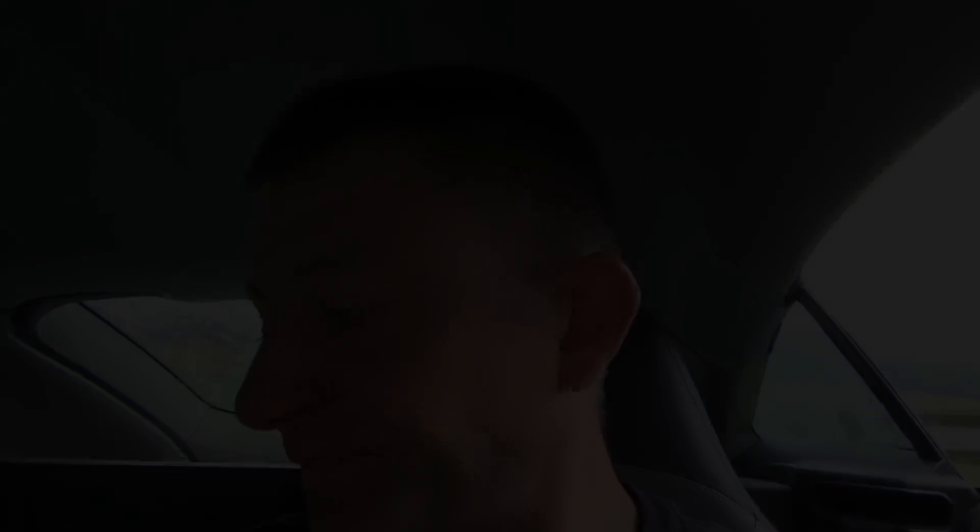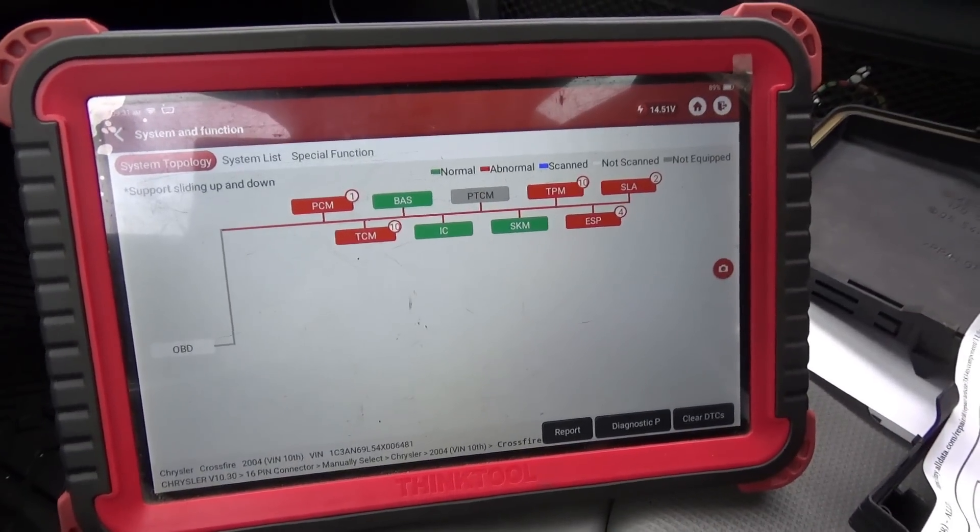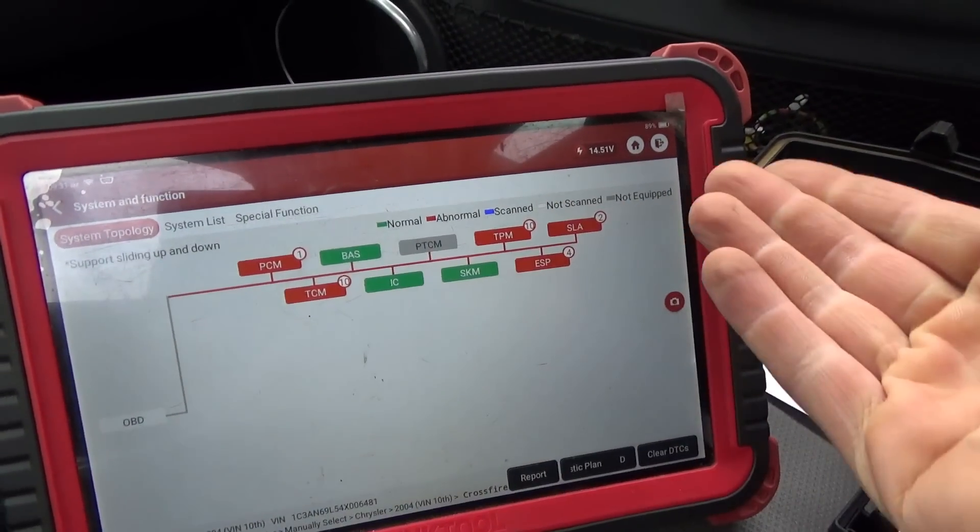Basically fixed. The power output from the traction system relay was missing, and when we bypassed the relay by providing power with a 5-amp test light, things started working. The car is now drivable. About 80% of diagnostic time is research — looking at wiring diagrams to explain the symptoms. We did just one physical check, but only after about an hour of research. Scanning now: all the modules are back in line. Fantastic — let's clear out all the DTCs.